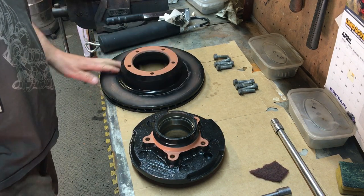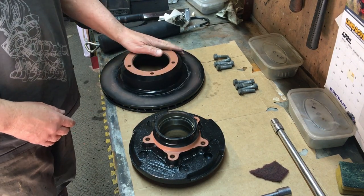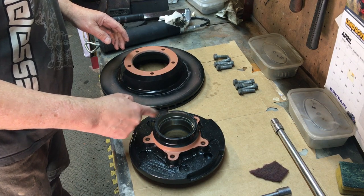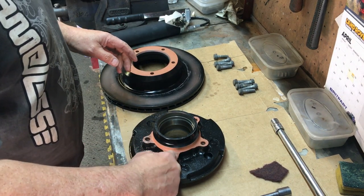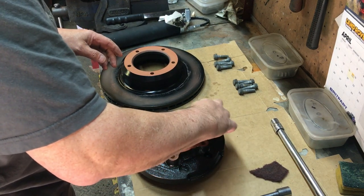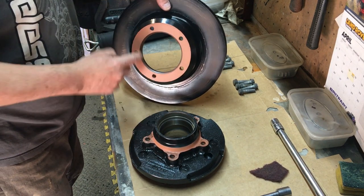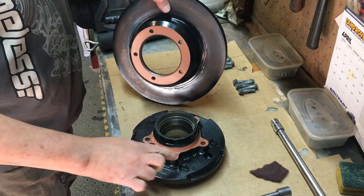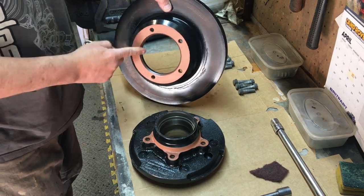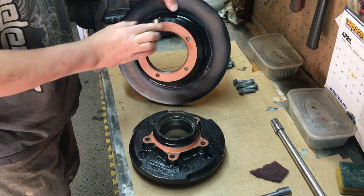Excess paint on the disc is basically just for protection. I've scraped away the worst of it and when we come to drive it, the pads will take care of that. I'm going to put a little bit of grease just to touch on the faces to prevent any corrosion build-up — it was all quite rusty when it came apart. You get capillary action pulling the moisture in, so I'm going to put a little bit around this bore as well. It's just literally a smear — it's not going to centrifuge out onto the brakes. It's just to help out when it comes to taking it all apart again.